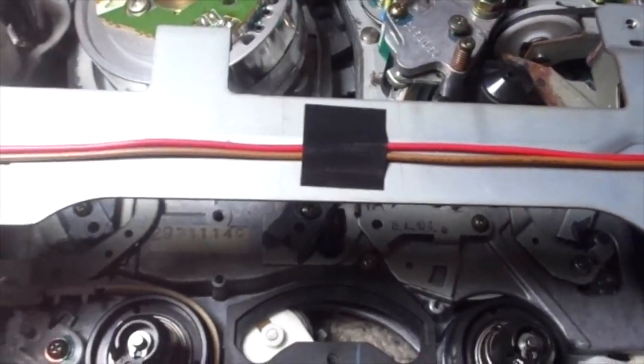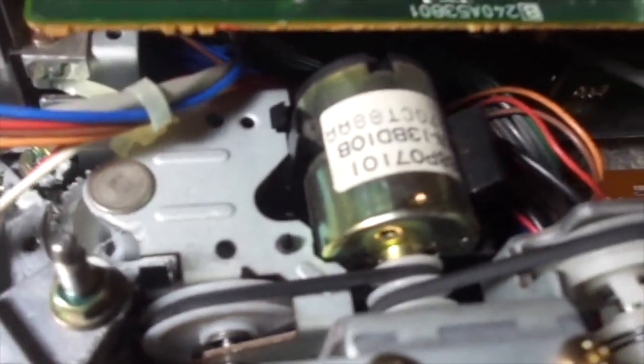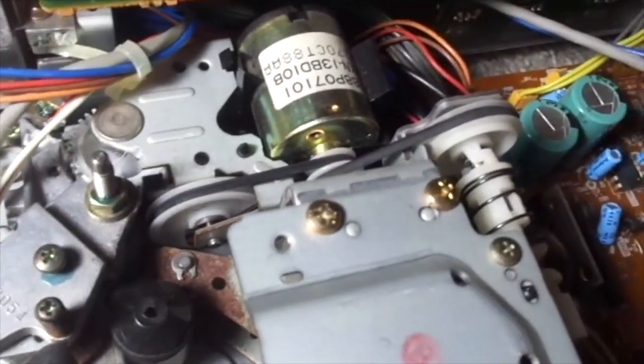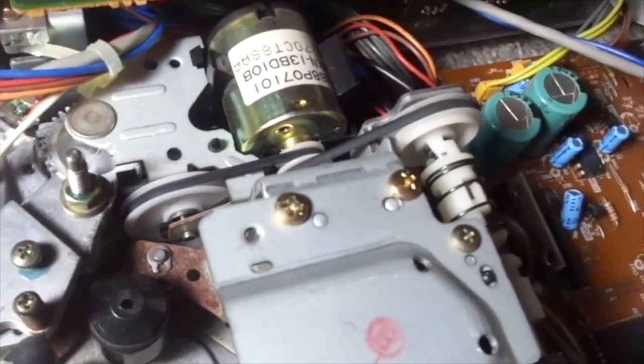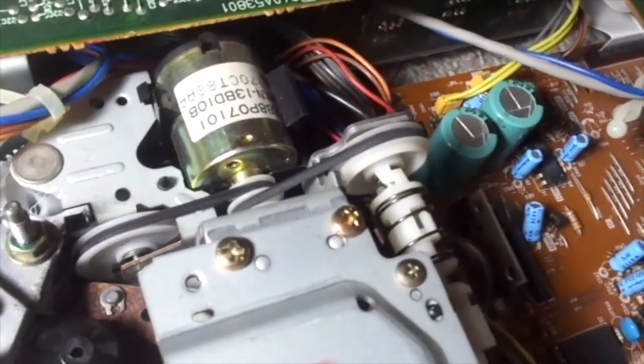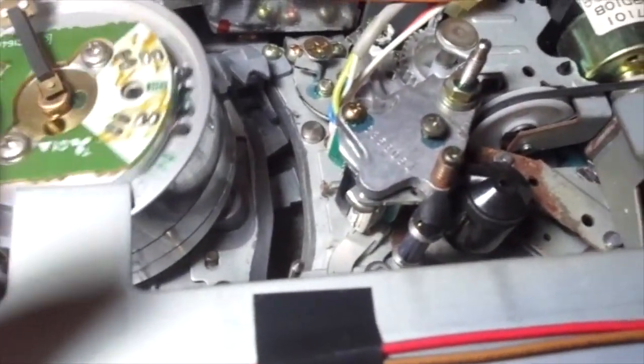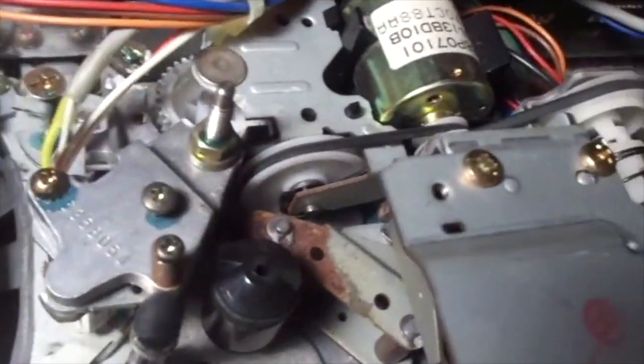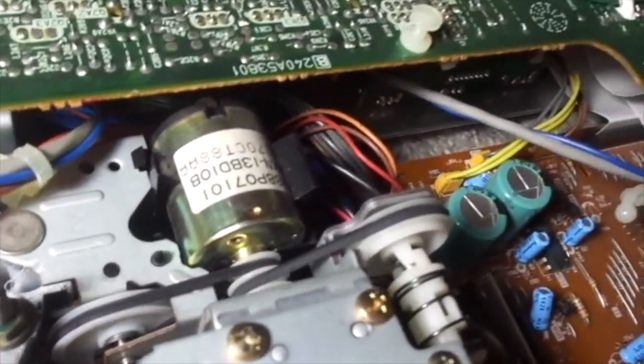The belt is all fine now - I replaced it and cleaned all that old goo off it. MrMiniscope actually has the same exact model too, but he doesn't find this mechanism as interesting as I do. I'll show you why later. The bottom side is pretty interesting on this one. This is actually a monaural model unit - it's not hi-fi stereo or even stereo. These VCRs are pretty nicely built. These are actually the original belts - they didn't need to be changed, but I changed them just in case. They're much tighter now, nice and tight.